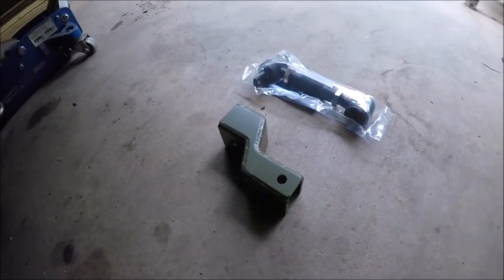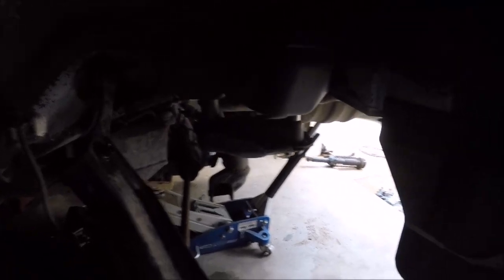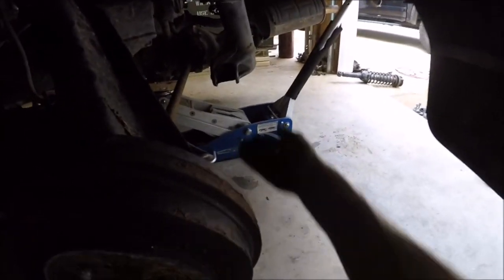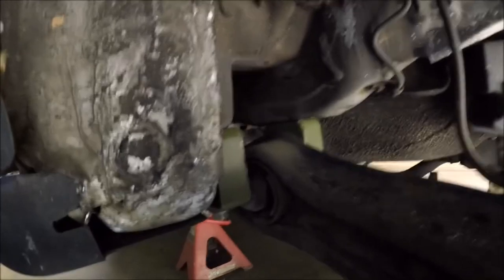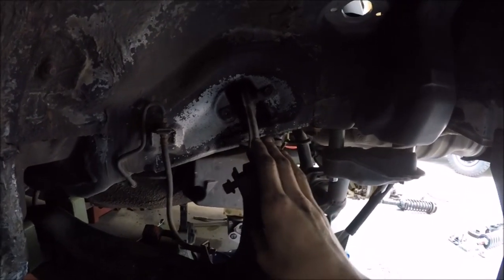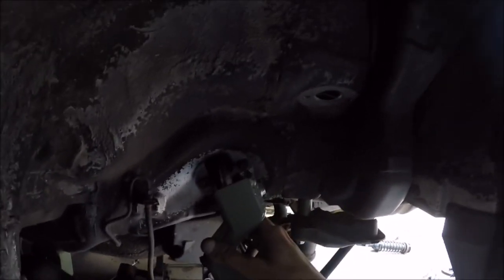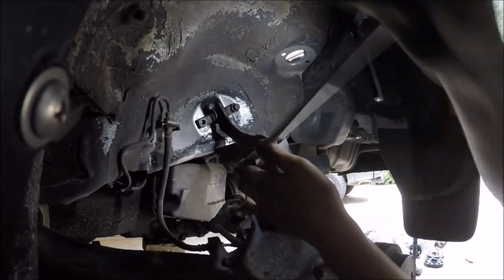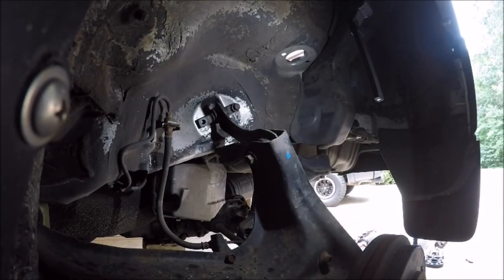Now that we have the trailing arm spacers and subframe spacers on, we're going to focus on the rear camber arm and the camber arm relocation bracket. The reason we do this is once you lift the car past 4 inches — really 3 and a half — the rear arms get out of alignment because the lower control arm drops with the subframe and the trailing arm gets dropped, but this gets stretched down and far forward, causing the car to wobble really bad whenever you hit a bump on the highway. To correct that, we bolt this arm in right here and it levels out the upper control arm so the mount goes straight across without any down and forward travel. There isn't much supporting the rear trailing arm right now, so I went ahead and threw a jack stand underneath it.